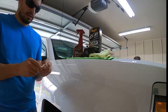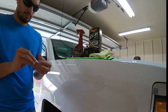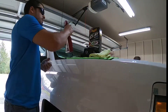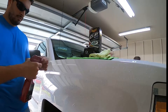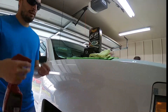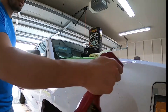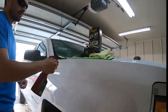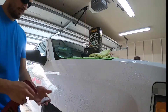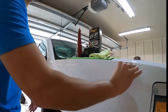So we're gonna make us a nice little clay patty — a little clay pad here. Now we take our quick detail spray from Meguiar's. You can see my panel's already wet because I just did the ONR wipe down. We're gonna use the quick detail spray because that's what comes with the kit and this works just fine. Heavy saturation is what I'm going to do. Then we hit our clay bar up and here we go — as you can see it's very white, very clean, fresh out the package.